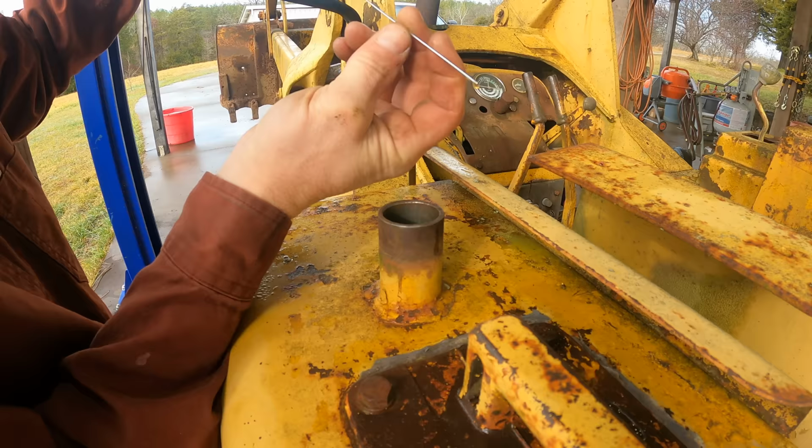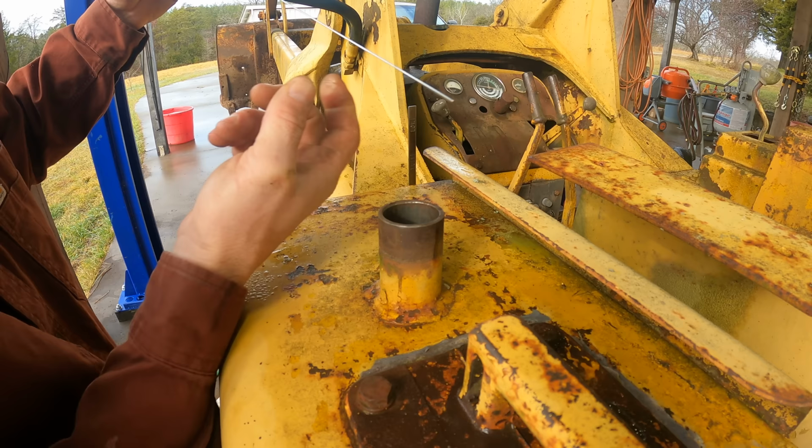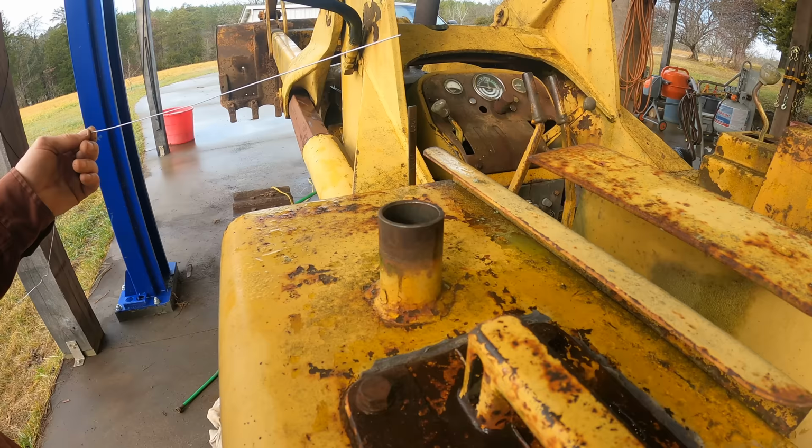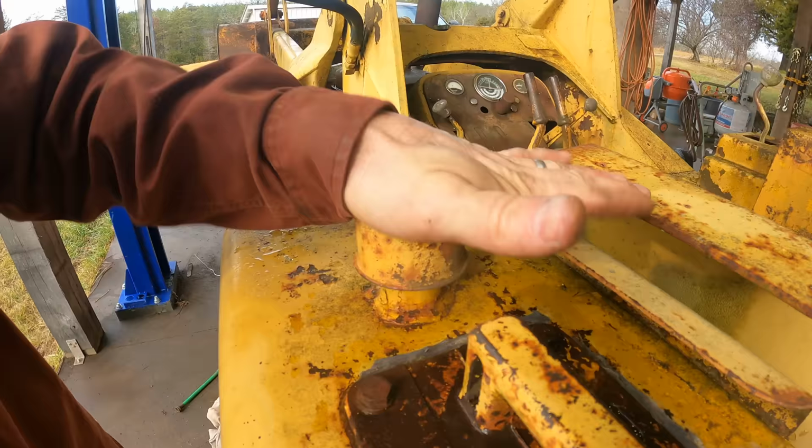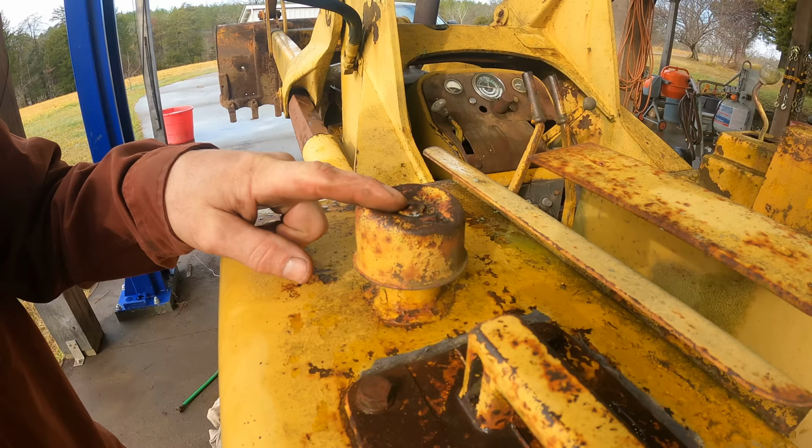Well, that tells me that there's probably a pretty significant leak somewhere. And of course this thing takes, I think, almost 5 gallons of oil. It's not going to be cheap to fill it up, but just to see what works and see where any leaks are, I'm thinking I may put in the hydraulic oil that was in my boom lift. I have a bucket of it that I saved for bar and chain oil. I can put that in here and just see what it would take to make the hydraulics function.